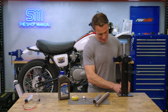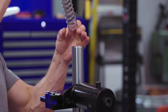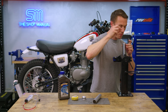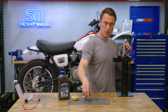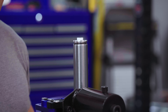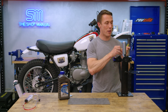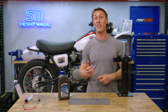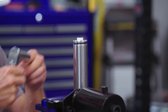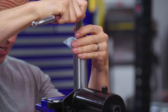With the oil set, fully extend the fork and drop in your fork spring, then washer number one, your spacer, and washer number two. Set the cap on and check your preload — we're aiming for about 4 millimeters, which is what we've got here. If it was sitting way tall, that would indicate the gold valve emulator is not seated properly in the damper rod. All good, so use your paper towel and socket and snug the cap down.